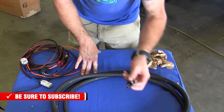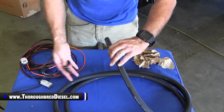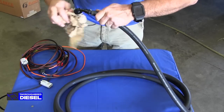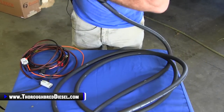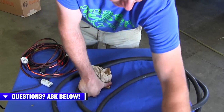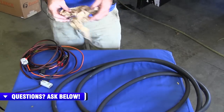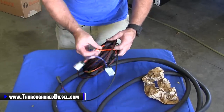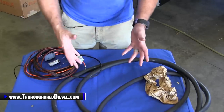Of all the AN fittings you get, the 45-degree is what you're going to install into your half-inch fuel line. I leave the whole fuel line together and then install my fuel fitting. Go ahead and lube the fitting up just a little bit, then push it in. Make sure you use a 45-degree fitting there. There are two more 45-degree fittings — those go at the filter housing. There's also a 90-degree fitting — that goes at the VP44. Have your wiring harness ready while the tank is down, because that's the easiest time to make those connections.